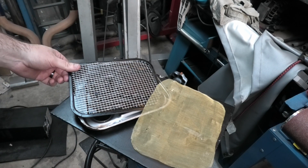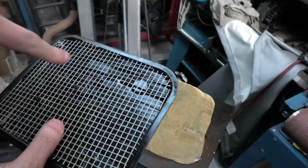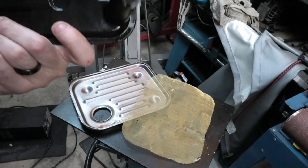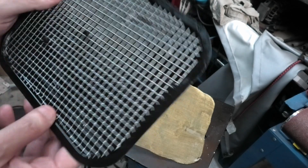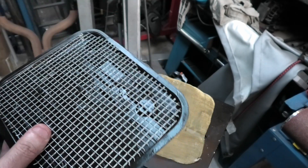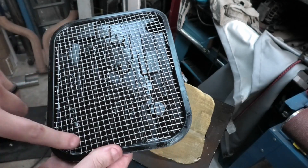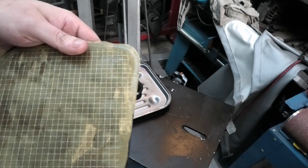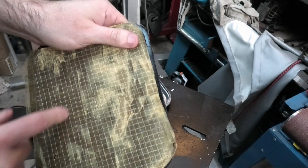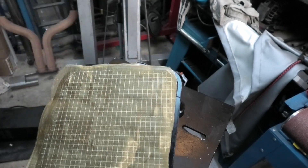There's likely other ways, and there is a risk with this as well — a risk that one of these little pieces might break off and find its way into the pump, which would probably do some damage. A better solution would be a 3D-printed plastic — something tolerant to heat and chemicals, like the same ABS or PA-66 this filter is made from — as an inside companion piece. Then you know it's fine, and if it did break off or melt into the pump, it's not going to hurt anything. Now, with this mesh in place, the pump's vacuum cannot suck the gauze completely flat and block all the channels underneath. If it does, your filter is completely full of dirt — you've got bigger issues. But it won't be blocked by that tiny amount of dirt that I had.